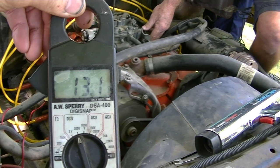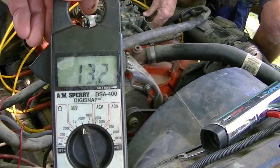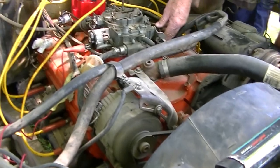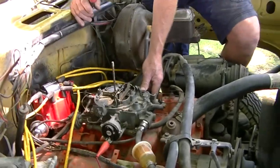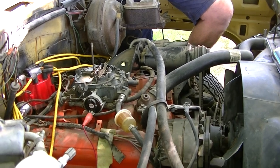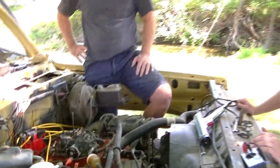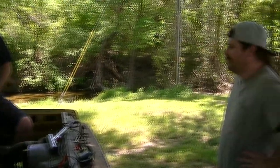What's weird is after it starts, you're at 13.1 — I think something is still going on there. So you still don't have a good connection or something is still going on. Hey Jake, what's up? I had it running so I'm going to let it cool off and see what happens. Something ain't right. Is it missing? Yeah, it started missing. You know, I've got a Chinese distributor in there and I wiggle the wire.